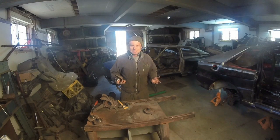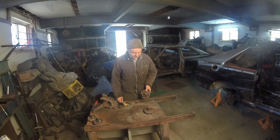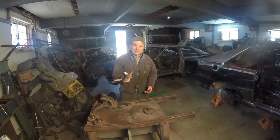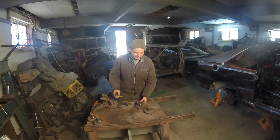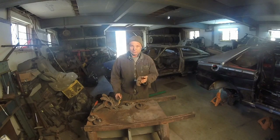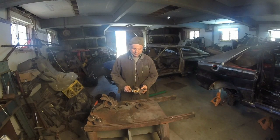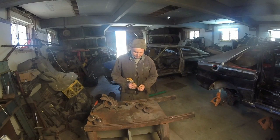95, I think it was, for the S6. I'm not sure if they changed it, but what we're looking at right here is the hub from a 91. If you take a look, the diameter of the actual shaft here is 43 millimeters. We're pretty close as far as my eyes can see it. This is the rear 4000 hub. Wow, no play. Push it in, 43 millimeters. Isn't that interesting? Take a look at this.